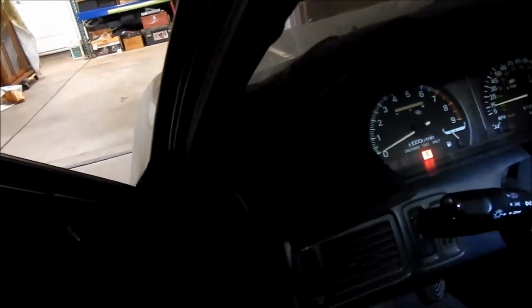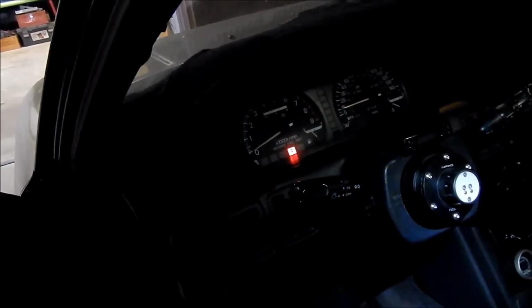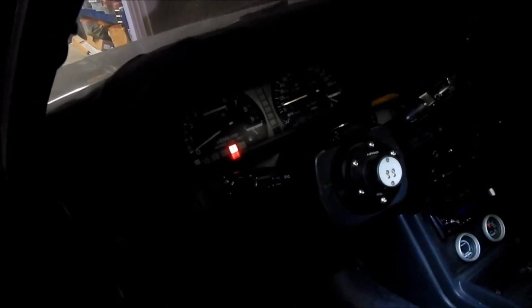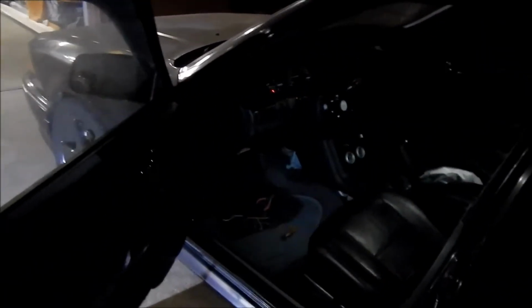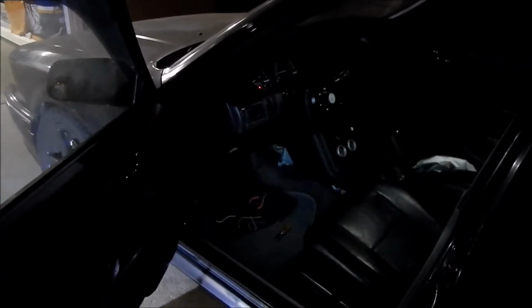So what's next is I'm probably gonna move these gauges up here. Let's unlock it already. I think I might install the AEM UEGO. I think it would work well on this car because it doesn't have a rear O2 sensor. So it won't care if you replace the O2 sensor. You can unplug the O2 sensor and it won't create a fault or a check engine light. This car is old, and it has less emissions stuff. It's not trying to regulate on you as much.